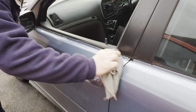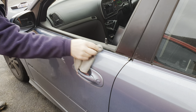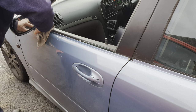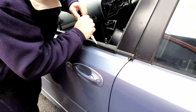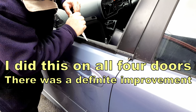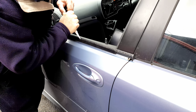Before putting your seal back on, give the area a clean — no need for it to be surgically clean, but whilst you've got the seal off you might as well. One thing I noticed is there's dirt all the way up this flange right to the very top, which tells me water is getting in there. I'm going to stop that by applying a very thin, roughly one millimeter wide bead of high quality silicone sealer down the inside of the seal carrier, so that when I fit it on it will squeeze all the way down around the flange and particularly on top of the flange.